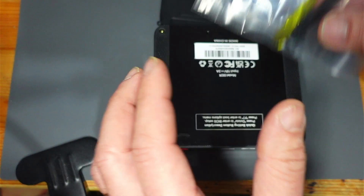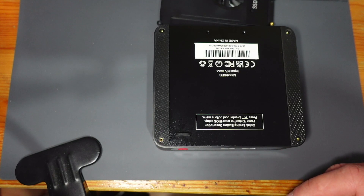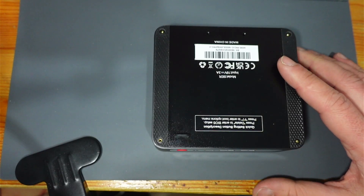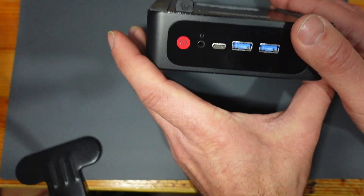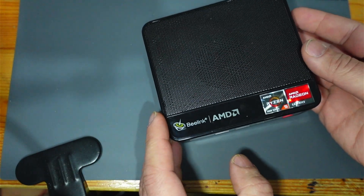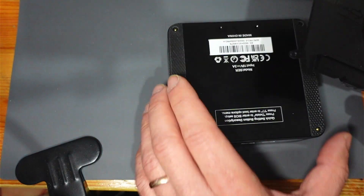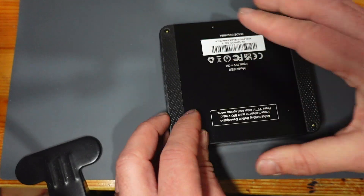The other thing I took out was the Wi-Fi, because even though it was off it could have been producing extra heat. The thing about this is it's all about heat dissipation with the Ryzen chips — that's the one thing you've got to do well, otherwise they'll start throttling. 75 degrees C is when this thing starts throttling, and that's pretty consistent; it's getting up to throttling speeds in games all the time. So it's all about removing that heat, and this cooler doesn't do that. In fact it makes it worse, because you're adding extra material into the case for no reason.